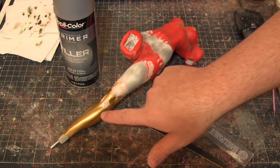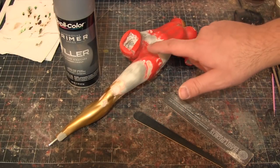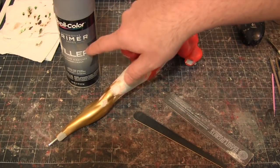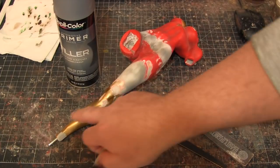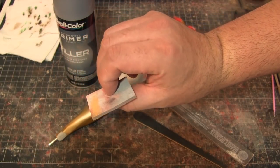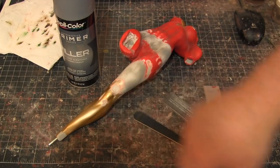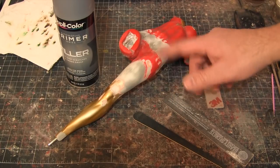The only problem with this DupliColor filler primer is that here it's a very smooth factory finish with probably a gloss coat, and up here it's very rough because I hit it with sandpaper. The DupliColor will do a nice coating on the rough area, but on the smooth gloss coat area it might start to bleed away. So before I do the filler primer, I'm going to get bigger sheets of 3M sandpaper and score the whole entire item — rough this up a lot. You just do that and it starts to dull it down, you can see paint gets on the sandpaper. Then before you spray, take a paper towel and wipe away the dust because you don't want to spray onto dust. That's going to help the primer stick to the piece much better.